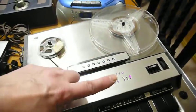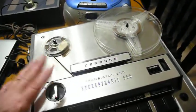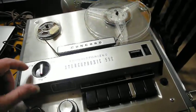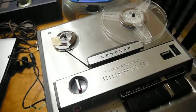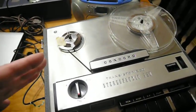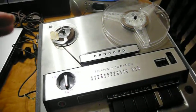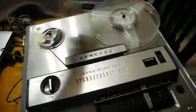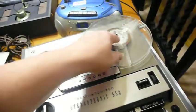It's like 8-tracks — one track here, two here, three here, four here, and you click to the different track. This one has a manual lever to change tracks, so you have to stop and change the gears to higher or lower speed. Once the tape has played all the way through, you take the reel off, flip it upside down, wind it through to the take-up reel, and let it play on the opposite side. That's why they call it 4-track — you can play two tracks on either side.